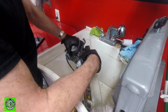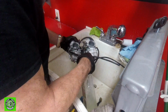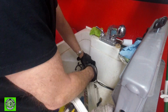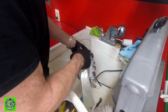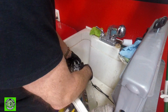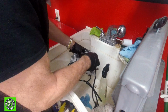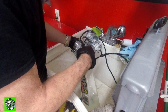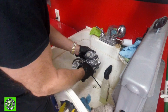Now, the one thing you have to be real careful of when you use aluminum brightener is the length of time it's on there. It only needs to be on for a few seconds, actually. It will darken things, and you don't want that to happen. But you can just put it on these pieces, and we'll rub it in a little bit. It's a very good cleaner too. Throw some in both sides. Give this thing about 10-15 seconds.